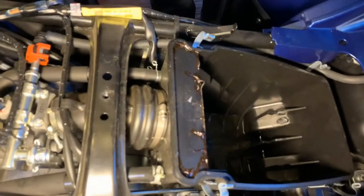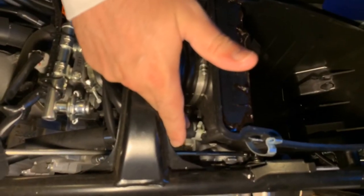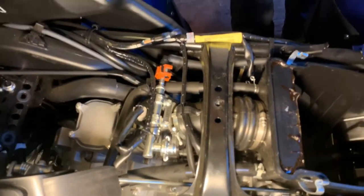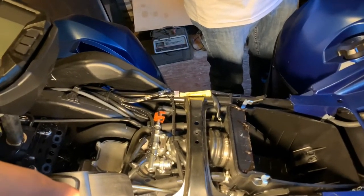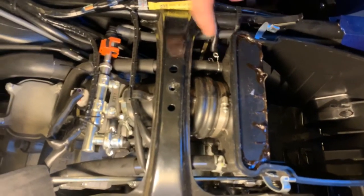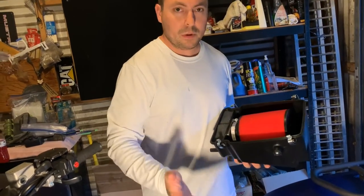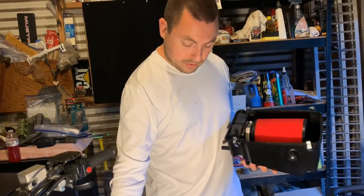They also remove this plastic plate here. Under it is a chamber — on this side you have your air induction system hose, which is part of an emissions system Yamaha uses. It draws fresh air from the air box, routes it through a tube to a solenoid valve, and goes into the manifold where the header meets the exhaust manifold port on the head to reduce emissions. Then you have your crankcase breather hose off the top of the cylinder head, which allows blow-by gases to vent back in and re-burn those vapors.